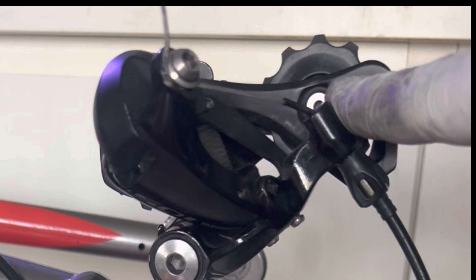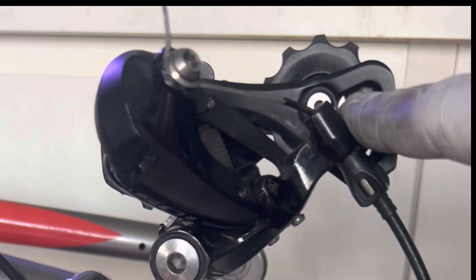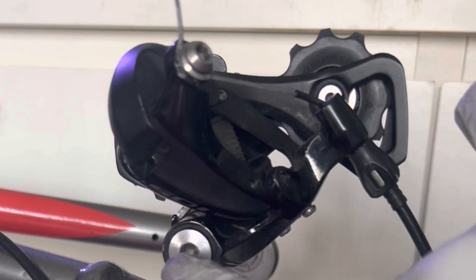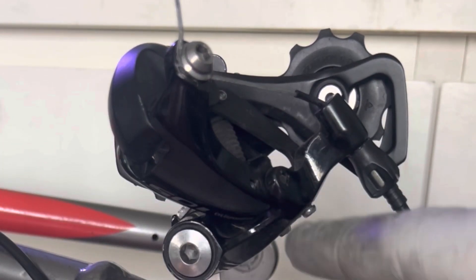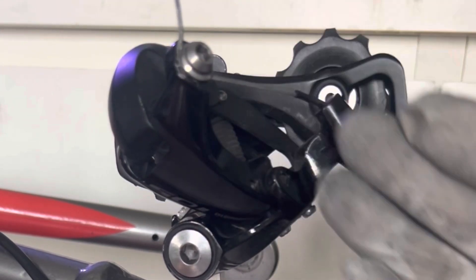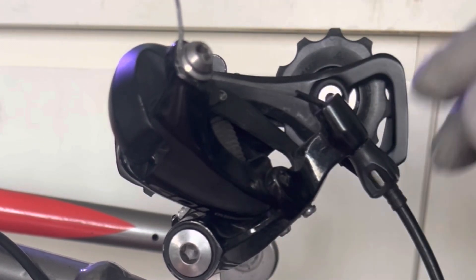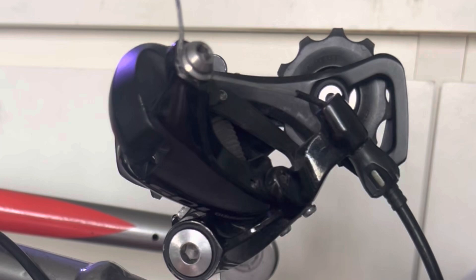The reason I got rust in the bottom jockey wheel and not the top one is because I had recently passed through a puddle, it was raining here a couple weeks back, and water got into that lower one. I forgot to clean it off, and this happened. So if you've already cleaned your chain, front chain ring, and pedals and the problem seems to be coming from the rear but it's not the derailleur shifting — most likely it's your jockey wheels. Pull them down, check them, make sure they're nice and tight after cleaning and reinstalling, and if everything is moving freely, they're good to go. Thanks for watching — catch you at the next one.